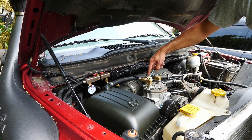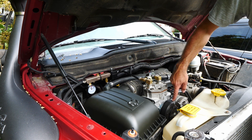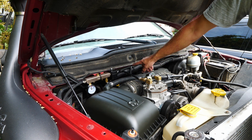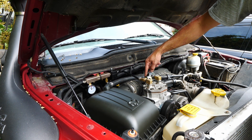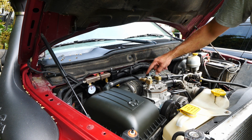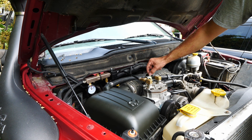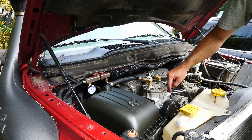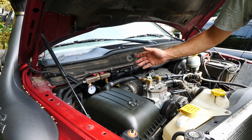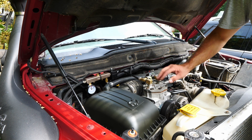Right here is our pressure switch for the AC compressor electromagnetic clutch. When we turn the switch on inside the cab, power runs through the harness into the switch, it completes the circuit and runs down to the clutch, engaging it. At 125 psi the switch opens, opening the circuit and shutting the clutch off. Once the pressure drops below 125 psi again, it engages and fires back up to that point. This is the fail-safe for the electromagnetic clutch.